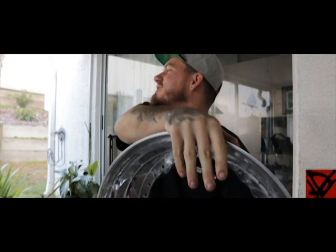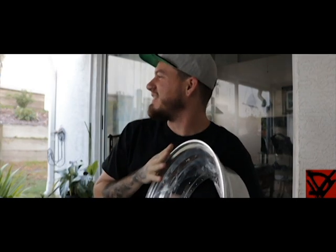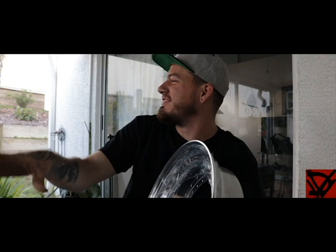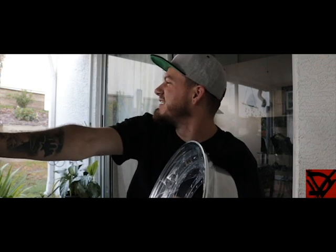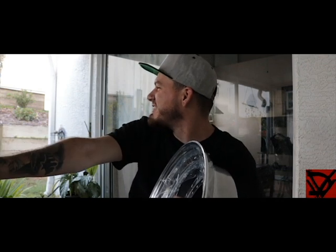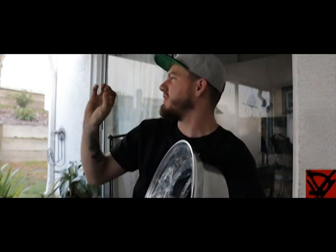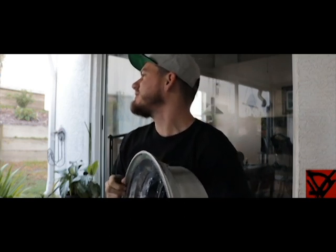Whenever we go to put the wheels together, I didn't know that the face would count toward the size. It might add like a half to it, and I was telling him how I may have to pull a little bit more camber in. Honestly I don't want to pull more camber in, because I like how the Civic sits. I don't really want to mess with the camber. But depending on what the face comes out to be, if it turns out to be a 10.5, I may have to go from that -12 to maybe -13 or -14. Or just a tiny little tweak.